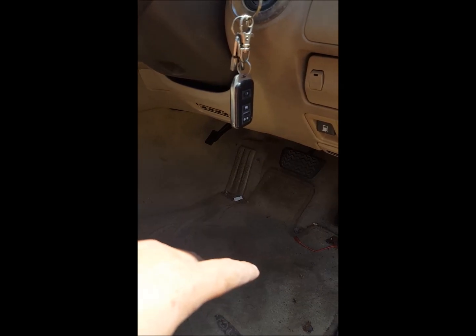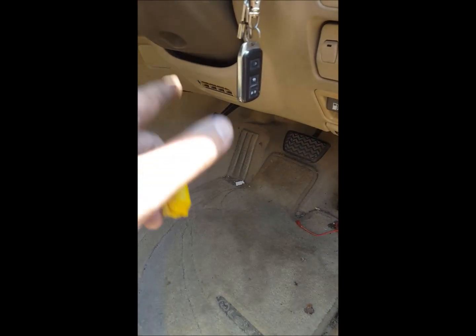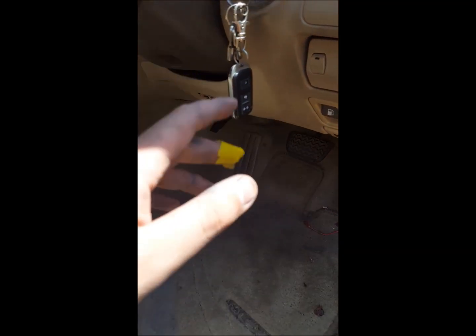You've got to bridge those out. That only works on LS430s — I don't know if it works on the later ones, it probably does. But on ISs, it's pin 4 and 13, so don't get those mixed up. But you can't get pin 4 on there anyway because it's not populated.